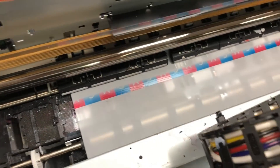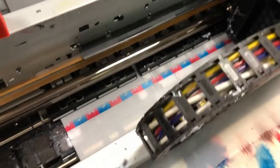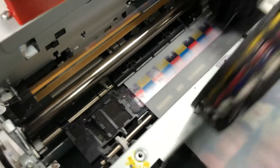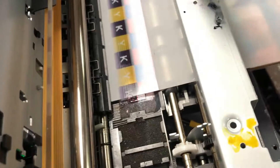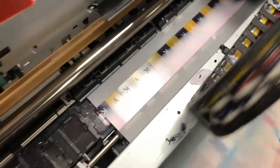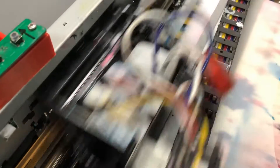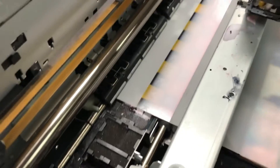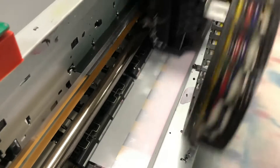If you want to leave your printer more than three days, you can add some water solution in the bottle — mix it with water. I'll put the link to the concentrate water solution in the upper right and also in the description. If you have a humidifier, you can keep the humidity above 50%, which is also going to help it last longer. This printer is in the office so we don't have that climate control, but just by doing this simple thing, we maintain it without any problems.